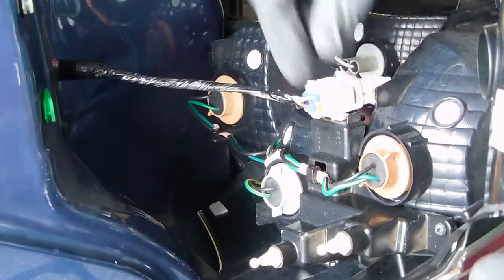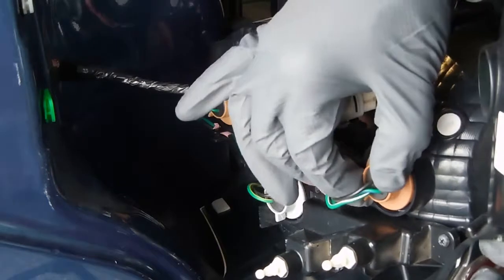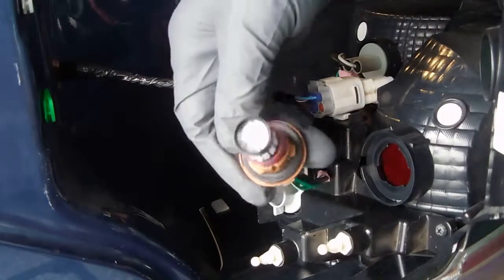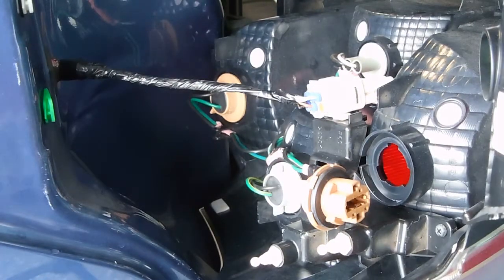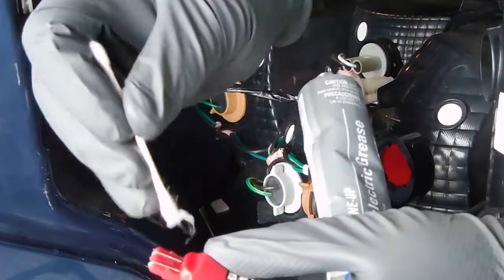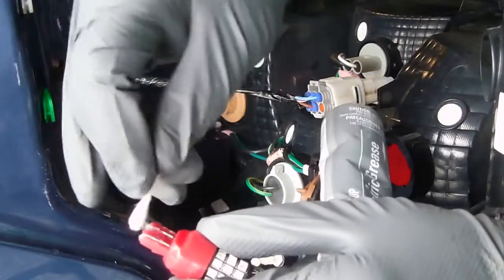To replace the lights — in this case the red lamps — I've replaced them with the ALA brake and tail light assembly. I usually wear some type of glove, and then on these contacts I put just a small amount of dielectric grease using a q-tip. Just get a small amount and put it on the contacts — try not to get too much.